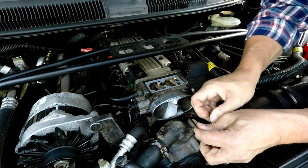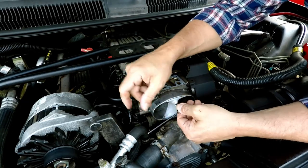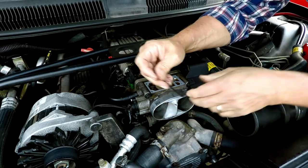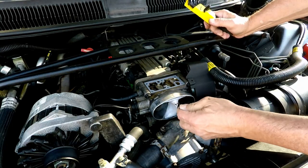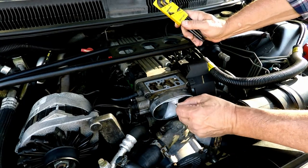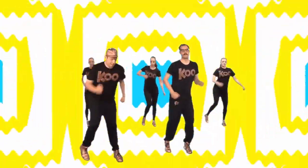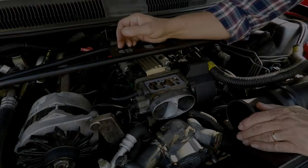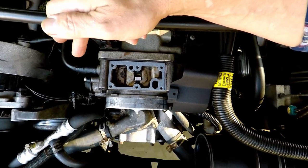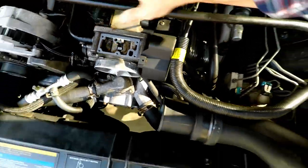You just want to snug it — you don't want to bear down on anything when dealing with aluminum. The bolt is long enough that even if it backs out, the piece will not fall down into your throttle body and intake. If you have a metric allen wrench set, the number 3 fits perfectly — better than the 1/8. That way you can tighten it down without any wiggle. There's still plenty of room for PCV bypass gases to flow into the throttle body.